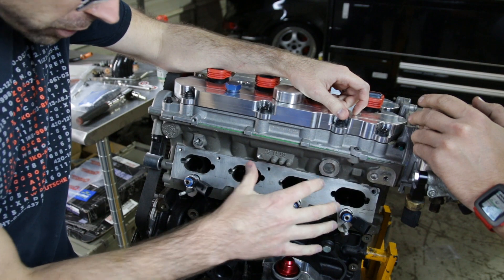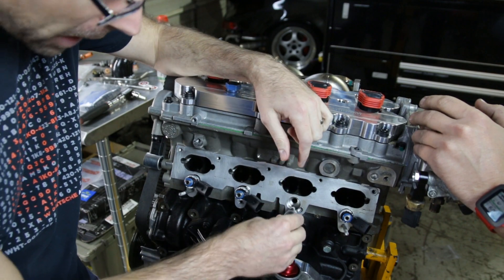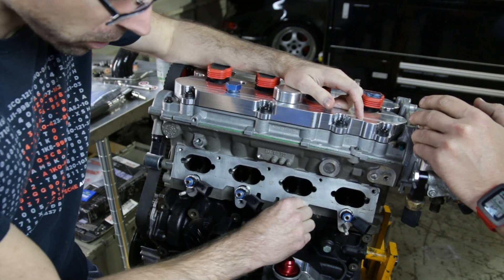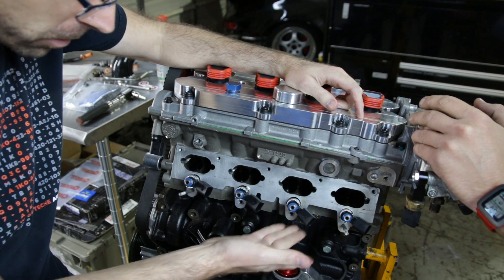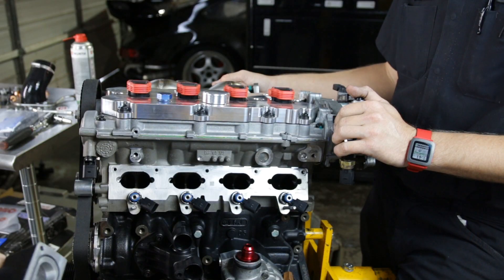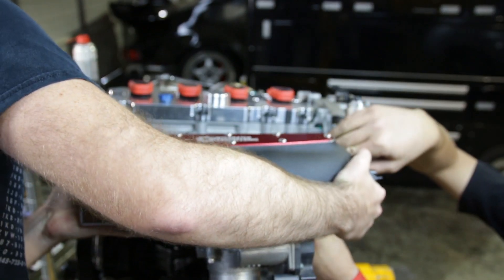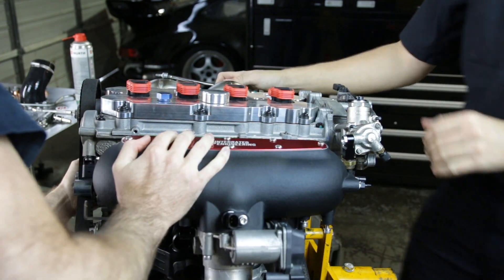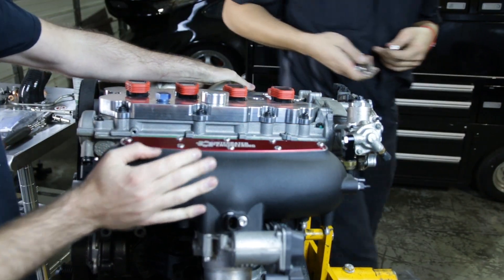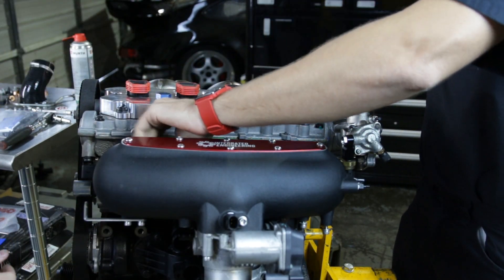All right, now we're getting ready to install our manifold. We are going to be installing all of our injectors into the cylinders first, because the Teflon seal at the tip of each injector actually has to be pressed in pretty good. We're going to make sure you have your orientation correct on your connectors — which is going to be towards the back of the engine — and then get all of our injectors seated in place. Now that our injectors are in, we're going to put our manifold in place. When we originally did the install we showed the injectors being installed into the rail first, but we found that made it tough to actually get everything into the head properly, so injectors seem to go in better going injectors first, then popping the rail onto the injectors.